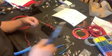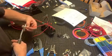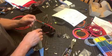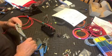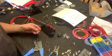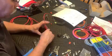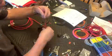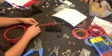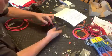My first bus bar, this is the battery feed for the first two fuses, what would be fuse 1 and 2, or the top two in the drawing, and those are going to be added directly to that battery feed. So I probably should have put those under that green piece of heat shrink when I was doing the others, but no big deal. I'll just move down the wire a little bit, strip it back, and then join that in. I don't even have to cut the 6 gauge wire this time. I'll just hook it in just upstream of that other, so it'll work.